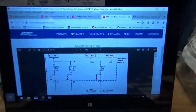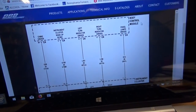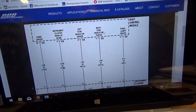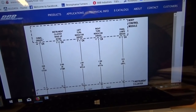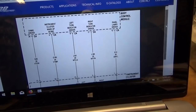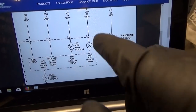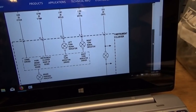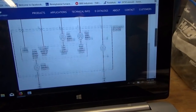We didn't see a wire going to the actual turn signal indicators on the dash — that's on a separate page. The BCM also controls the right turn indicator driver, left turn indicator driver, and also the chime. That goes up to our instrument cluster — there are the bulbs, and those blink dimly.